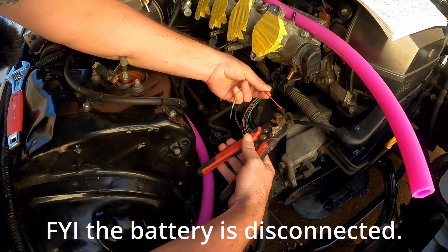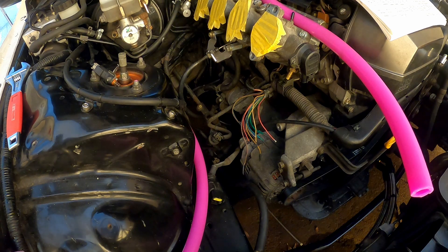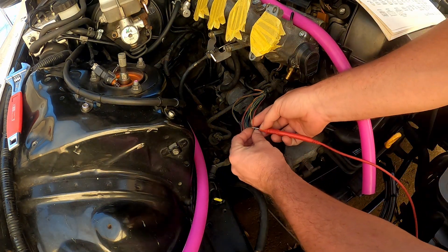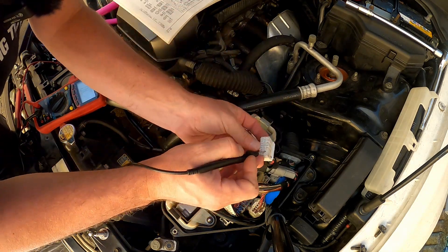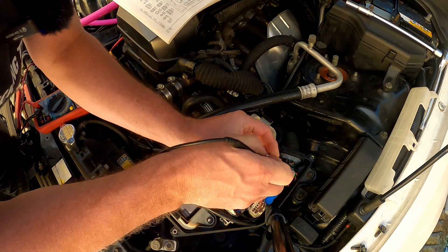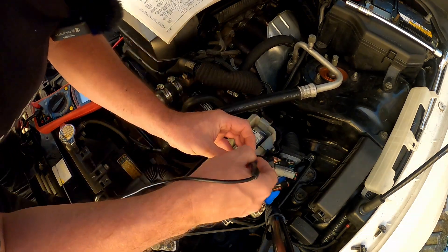I'm putting my money on this red here because it's sort of floating with the yellow. So let's just take about that much off - expose the wire. Connect one side of your multimeter - doesn't matter which side - to the wire. There we go, so that's just floating there. Now the other side: take your other probe and find the wire that you want. I don't think it's the one I was guessing. It's not that red one.